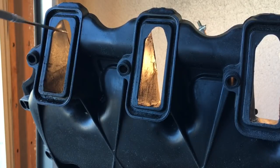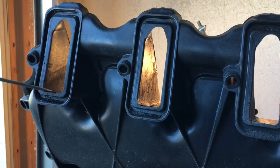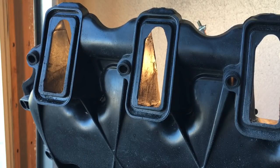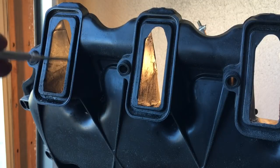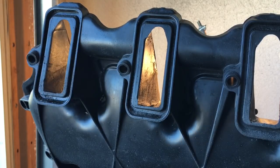I know these intakes respond very well to opening up this port to a real full size opening like you would have on a cylinder head or a performance gasket — blending it all the way back, texturing it, a little bit of opening up here at the top, because you don't need that real tight cathedral opening at the top. You gain nothing. Even when you do cylinder head porting, that cathedral gets opened, not to a complete arch, but opened quite a bit. But I just wanted to show you guys what I was working on — porting out this Dorman plastic truck intake with the super tall runners. It's a three-piece design, with the lower intake, the upper runner and the lower runner that goes together, and all three pieces screw together. That's where we're at and that's what I'm trying to do. Thanks for watching.